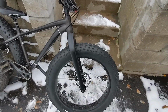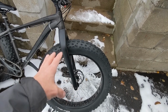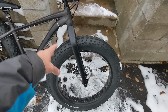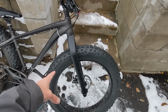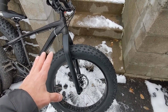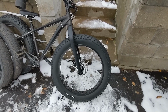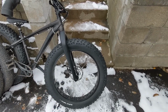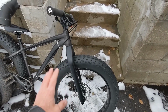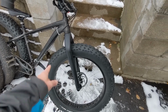That's been a popular setup on a lot of newer fat bikes, 27.5 by 4.0, and a lot of people say that's as much traction as a 26-inch wheel with 4.8s or 5.0s. I'm skeptical, but I can get a set of wheels and tires set up that way and try them on this bike. We'll see if I do that. It's about an $800 to $1,000 investment to do that, but it might be worth it, because if those other wheels are faster for certain conditions, especially if I decide to do any fat bike races, those might be a better option than running these guys.